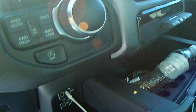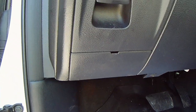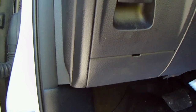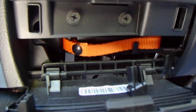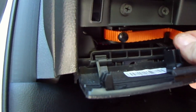The way to do that in this Dodge Ram 1500 is right here — there's a little panel right under the parking brake. You want to take something and put it right in that slot, pop it open, and you'll see this little ribbon connector here.